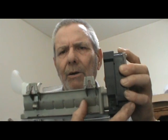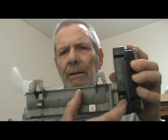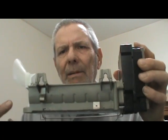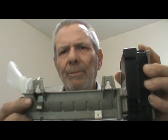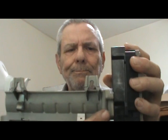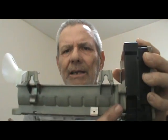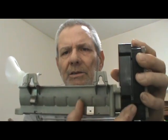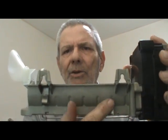They changed their new ice maker so that it has a pigtail with a plug out here — it's about three inches long, but it's too short to go all the way to the back of the ice maker to plug into the back wall. It was on back order for over a year and a half and wasn't even available. People were getting some of the ice makers but they didn't have the harness. It's like an extension cord — the pigtail comes out of here, it's wired in so you can't unplug it, and you have to have an extension cord so it'll reach the back wall.